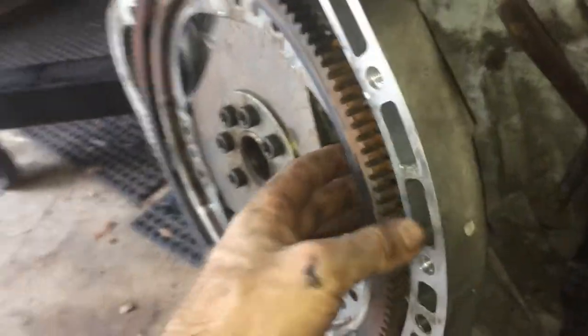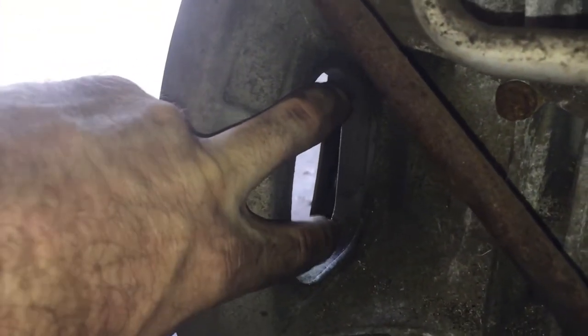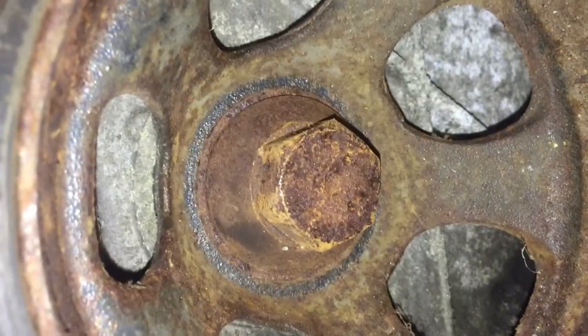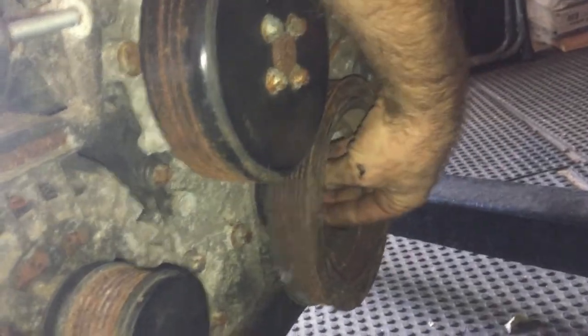And you see the little sneaky, remember I was telling you there's a door back there? I was like, oh, it's back here. Well, here it is on the motor. Here's the door. You pop this little piece of metal out right here. See this little metal? It's just a dust shield. You pop this out. There it is. Boom. Popped it out. And then you stick your wrench in here and you do 1-2 at a 13. And then you come over here. This is the crank pulley. And I put a 1 1/16 on here and I spin the crank pulley. So you see where it's at, right? This is the crank pulley. It turns your crank.